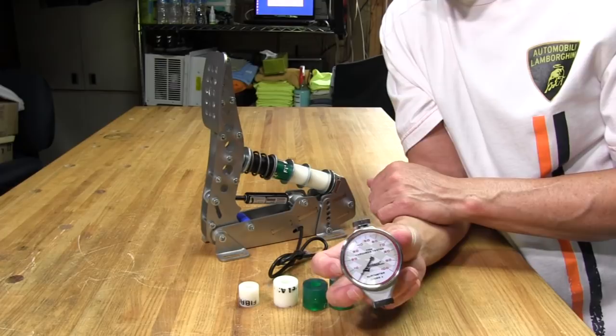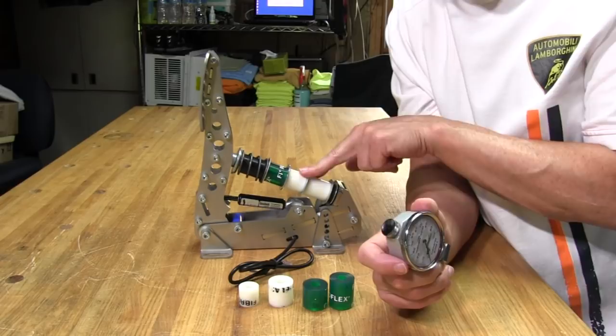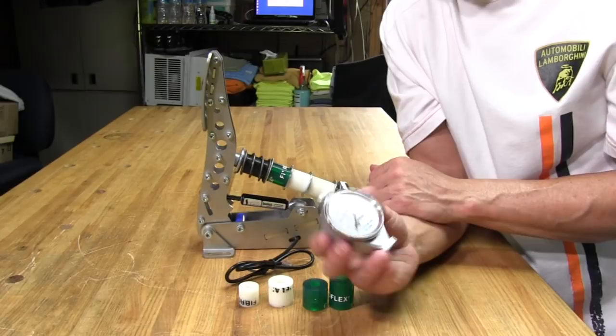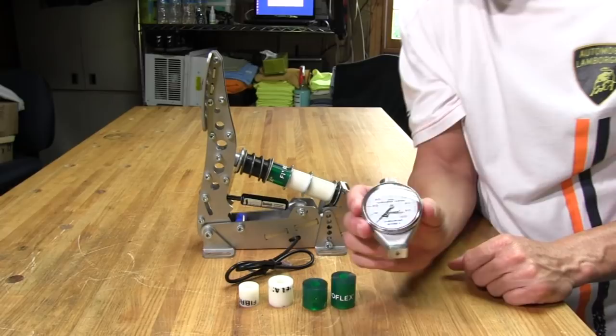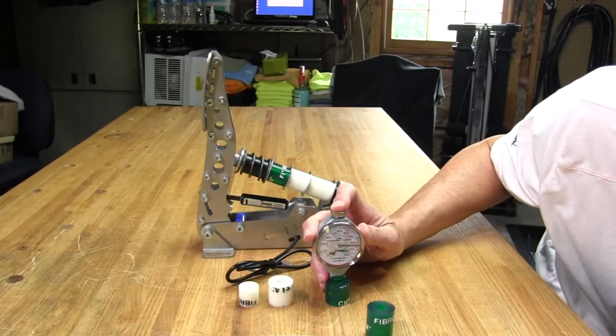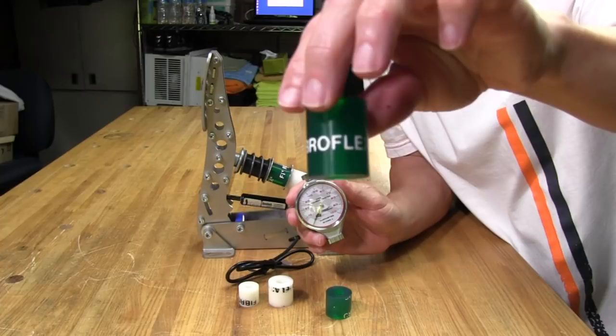It's also fun to play around with bumpers. Sure, they're going to wear and you'll have to replace them — racing is wearing stuff out and replacing it. You really need something like this if you want to play around and keep accurate readings. It's not that expensive and it's fun to use. Also interesting is the consistency across the bumpers — this one was 85, and looking at the little one, it's also 85. So both green bumpers are right on the same durometer reading, which tells me that Fibroflex has a very low tolerance. Their tolerances are very tight on the durometer ratings for these bumpers — they're very nice bumpers. I've pulled other bumpers out of packages before and they were all over the place when supposed to be the same hardness.